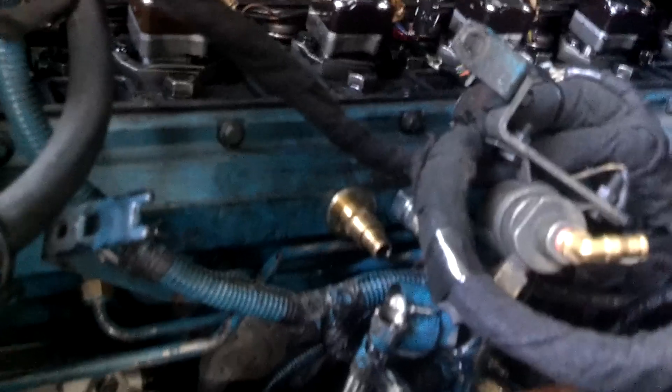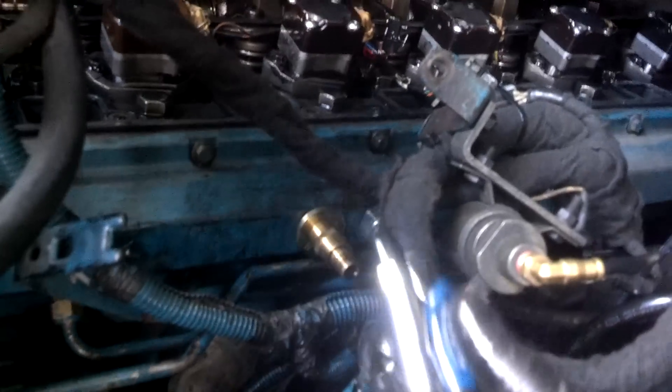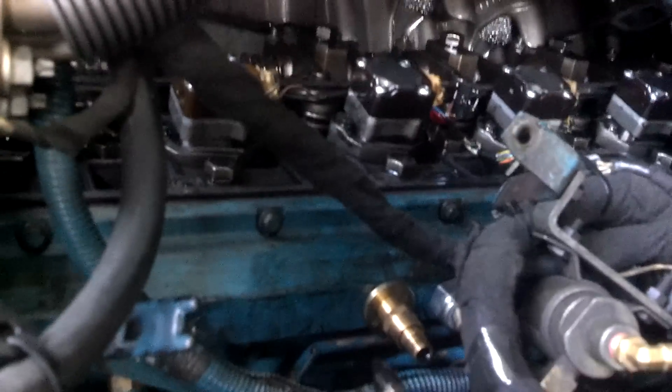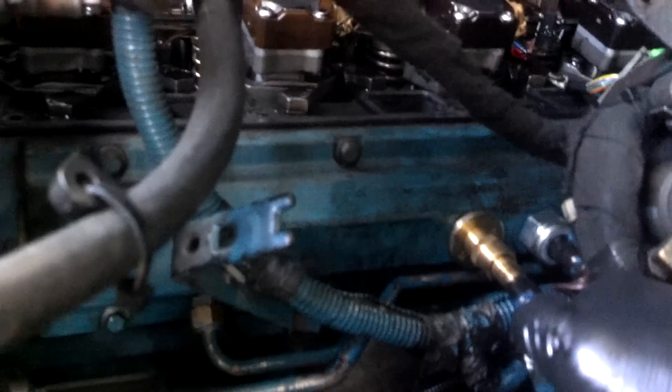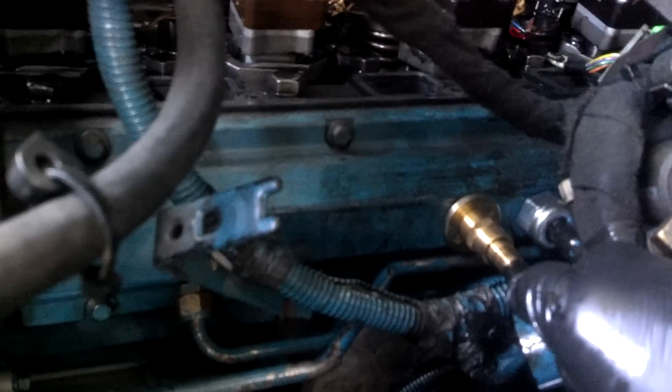It's not building oil pressure — oil pressure should be about 800 PSI but we're only getting about 200 PSI. So what I do, I put my adapter piece in, just something I made up from stuff laying around the shop, making sure the threads fit. I hook up just a little bit of shop air to it and then I just bump it a little bit.